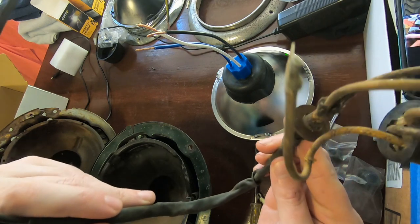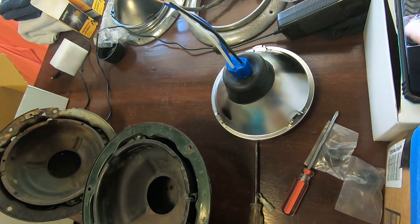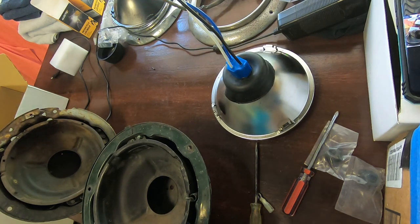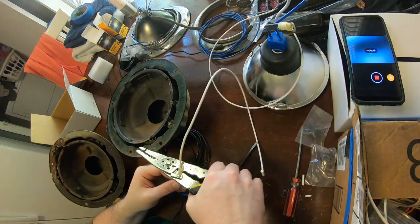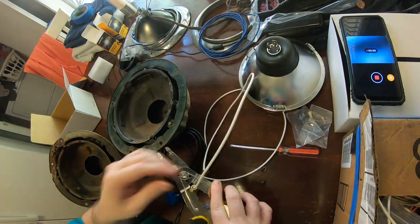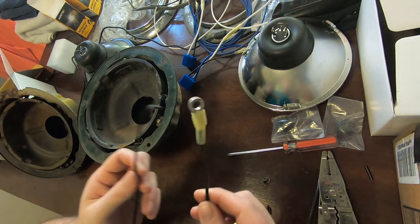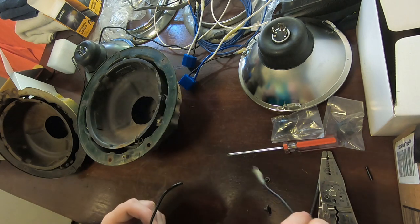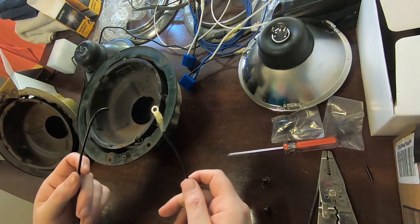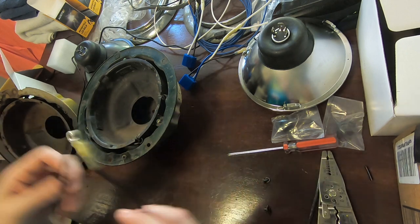I have the technology. I'm gonna just build myself a quick harness for this. With everything nice and shrink-wrapped, I've actually gone ahead and made it an actual ground wire, because I don't know that these screws and this grounded against the grill will actually provide enough ground potential for it to work. So we're just gonna make sure of that.